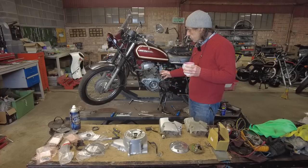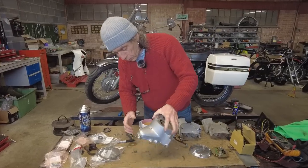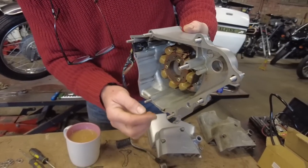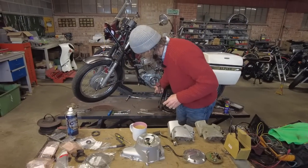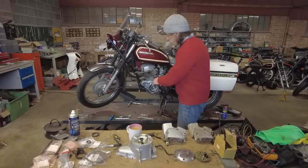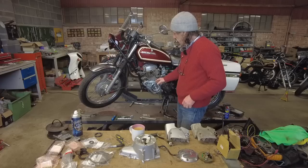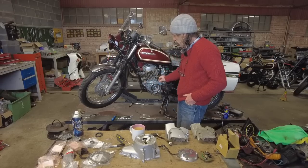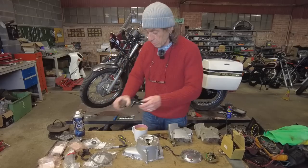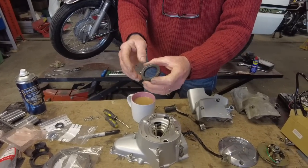In the meantime I've stripped it all out, because what I noticed was there's a breather hole in this case which you can see here. There's a little breather - the oil, if it gets into this case (which should be dry), goes in there and out that little gallery and out there, and that was dripping oil. It ran down the crankcase. The only way oil can get in there really is if the seal on the crankshaft is gone, which involves taking everything off. I've had this off - the rotor that's got the starter motor clutch in it, that chain and sprocket - pulled that off, then this plate comes off and you can get at the main seal for the crankshaft. I think this was just slightly weeping and contaminating the points with enough oil to stop it sparking properly.